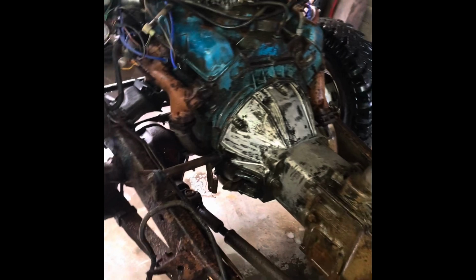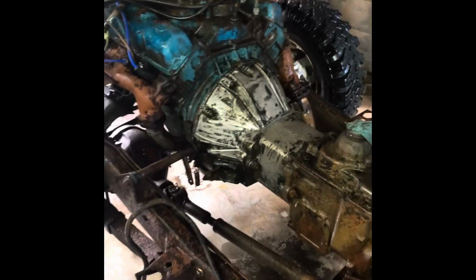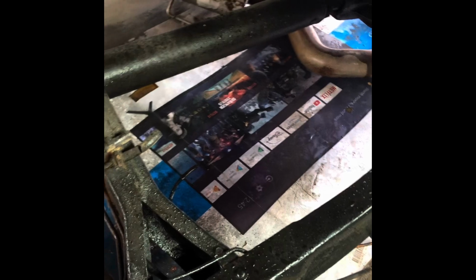All right, so washed the engine down. I had covered up the carb during this event. The motor's still good. I am going to pull it out and have it refreshed at a local shop in town. But I wanted to get all the oil and grease off. It seems to maintain oil pressure at 60 psi when idling. It's not burning smoke. There's no ticking, knocking, any funny sounds, even after having sat in the field for over 20 years.